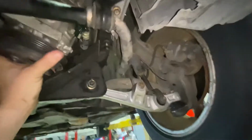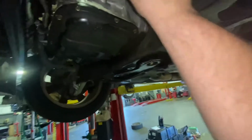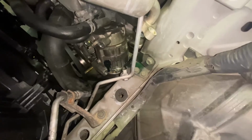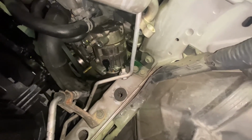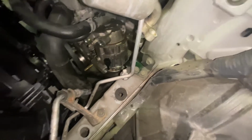Now, will she fit past the sway bar? K-member and our oil cooler line right here. That may be a no. I may have to drop the sway bar. Just for a compressor? That's no fun. Maybe we can get her out top. Yep, I'm gonna try to get her out top. Come back. Okay, so that's our little finessing. She don't come out the top either, so sway bar's gotta come down. That sucks. Oh, let's get the sway bar off.